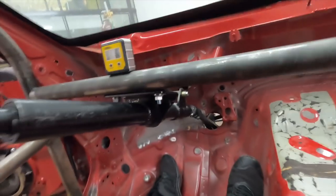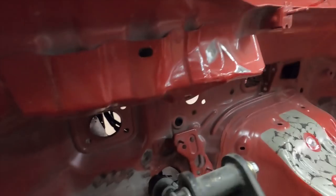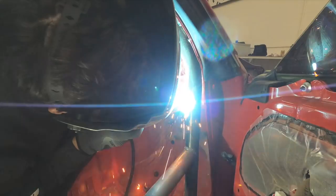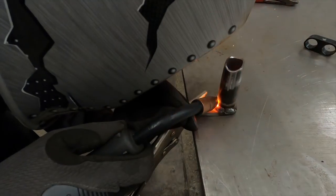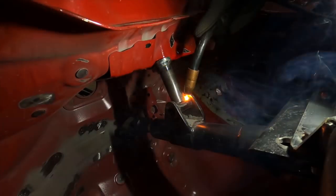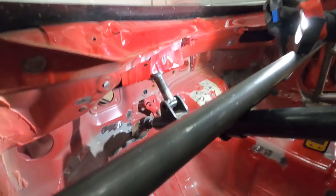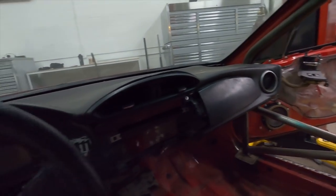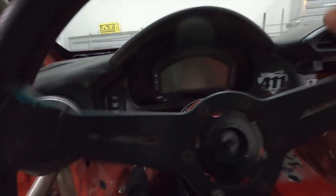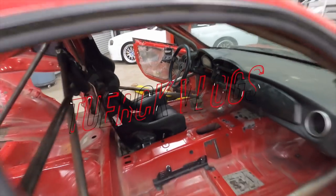Steering column's in, we are tacked up. Pull it back out, Dom can finish weld. We probably have to do another bracket from about there down to there because this thing is going to flex up and down quite a bit. Otherwise she is in a great spot — great position. It's a little ghetto but it's working. Dash in — it's not like it's hooked up, but it just makes the interior look a million times better.